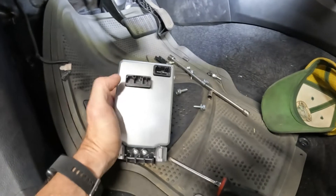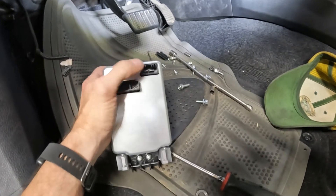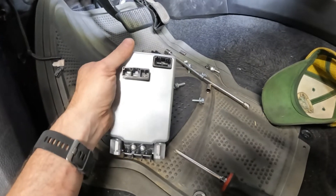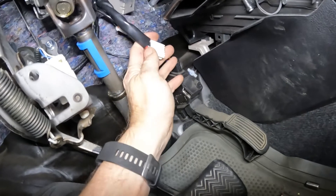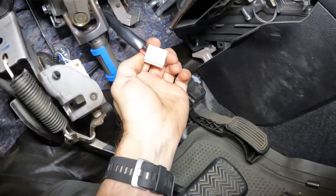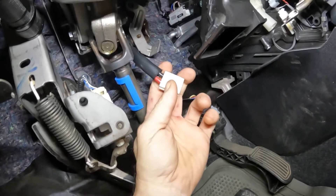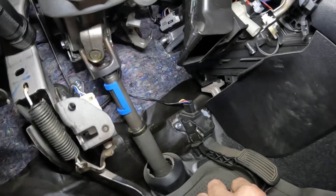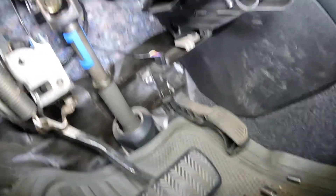This is the new computer. In the car I was able to unplug some connectors while mounted, but one I was unable to unplug in the car. Luckily when you unplug the computer and swing it down, the wire harness pulls down pretty far so you can get to it. This is your main power and ground supply — it's on that 60-amp lead — and that's why it was killing the battery, pulling way too much power. I'm putting a little dielectric grease on those ends and then wrestling this thing back up into the hole.